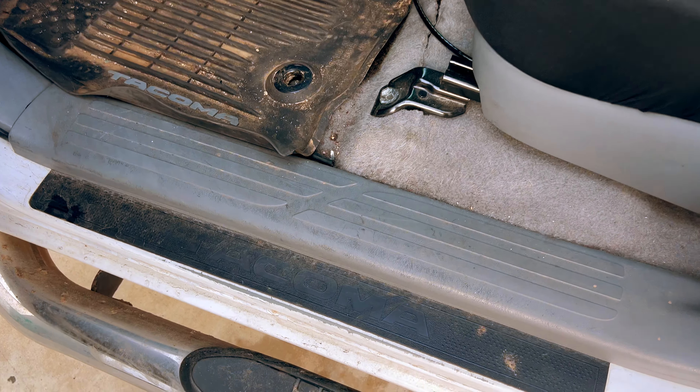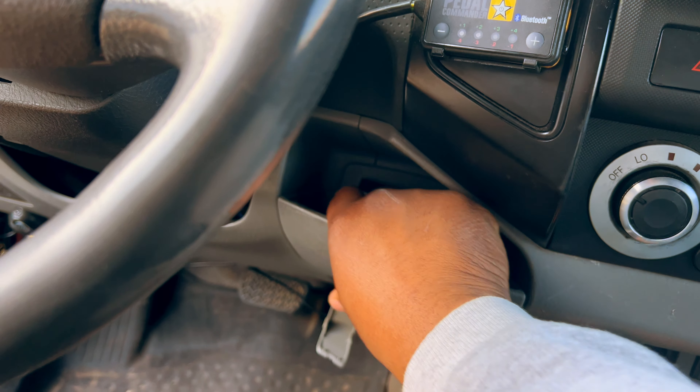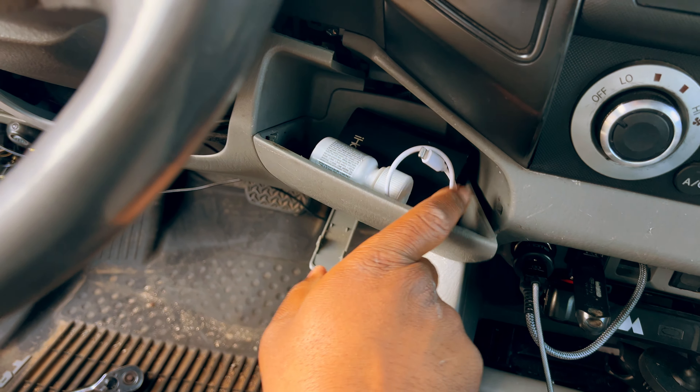This will get this portion out of the way — this is my wiring harness for my switch panel, it's kind of cramped in here. Your next step is to remove this 10-millimeter bolt right here, and on the other side is another 10-millimeter bolt under this little flap. This will release the entire bottom of the kick panel section, and you should be able to pull down from the center of the panel.